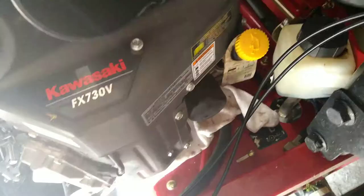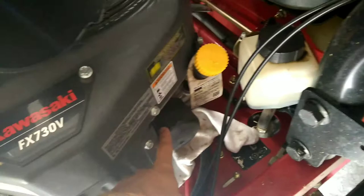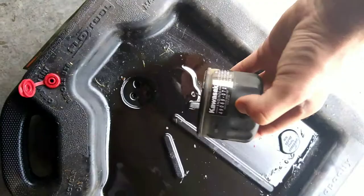After the oil is all drained out, now it's time for your oil filter. My pro tip is you put some grease rags down here because you're probably going to make a mess when you pull that filter off. It shouldn't be any tighter than hand tight, but it may be tight enough where you really have to get some leverage on it. If it's too tight, you'll have to get an oil filter wrench. Break the seal — you may have to use two hands — then take it off. There's going to be oil in there, as you guys can see. Let it sit for a minute to let any extra oil drain out, then get some grease rags and clean it up real good. You don't want to leave your mower covered in oil.